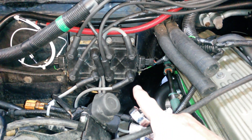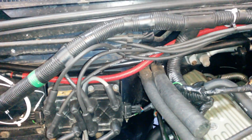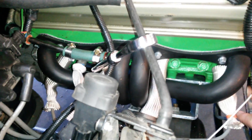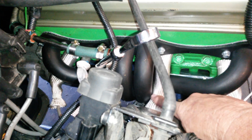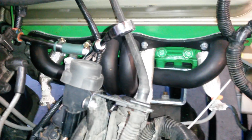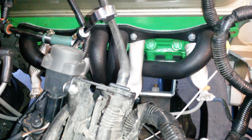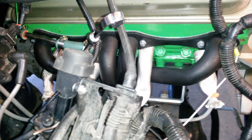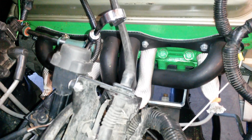I use a lot of white wire because I have aviation wire in my hangar. That's the ignition module — I made up these wiring connections myself with a kit. On this side the header is pretty close to the exhaust system, so you can see these white little booties here — they're meant to keep the wires from getting too hot. On the other side I didn't have that issue because the wires come straight out.